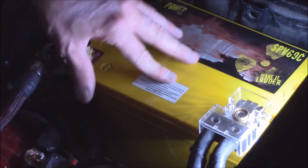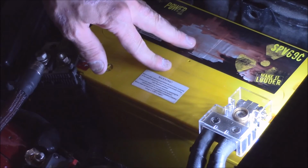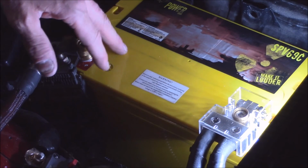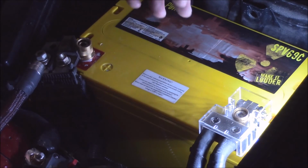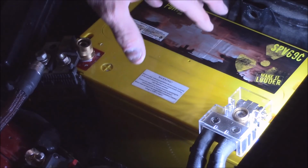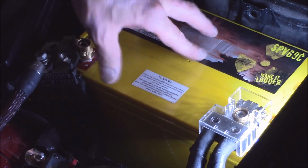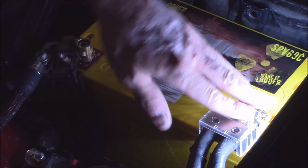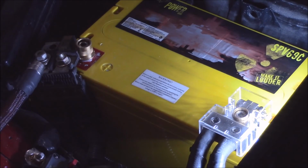And one of the bonuses is, if you do everything right, you have a better electrical system. You won't see headlights blink, you won't see the interior dome lights blink, you won't see the gauges on your dash blink. All these problems will go away because you've upgraded both power and ground. So that is the reason why you want to buy a Big 3 kit.